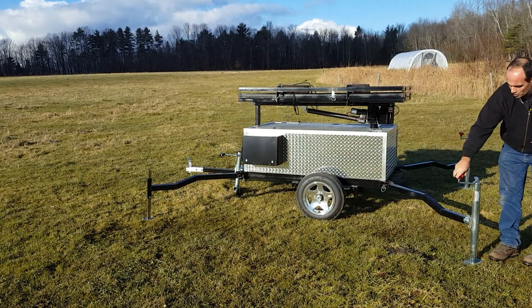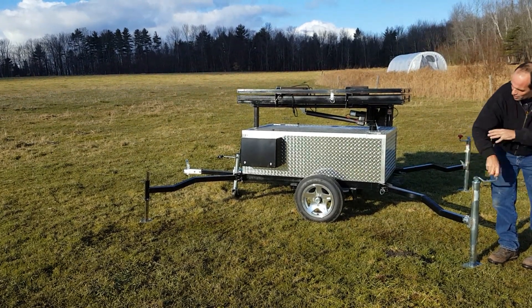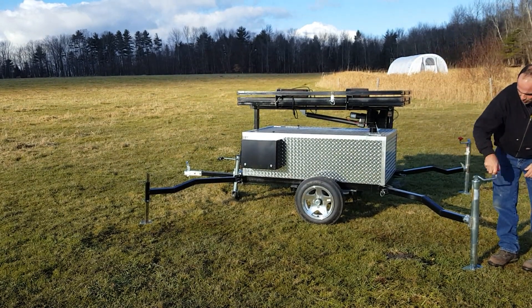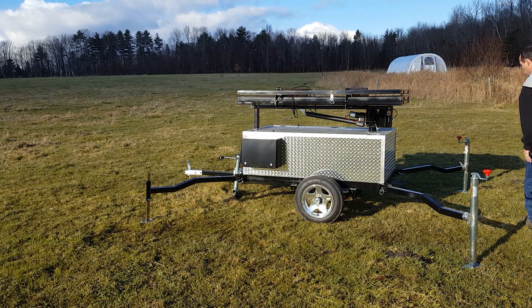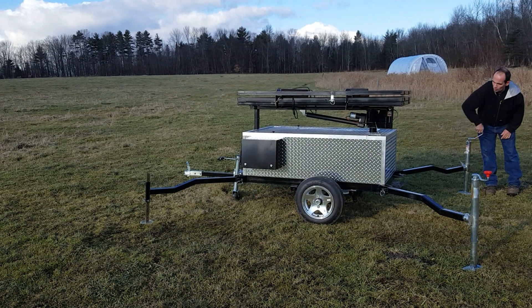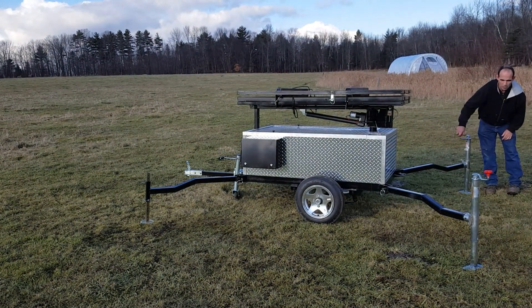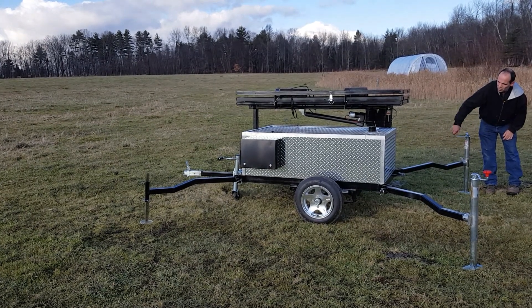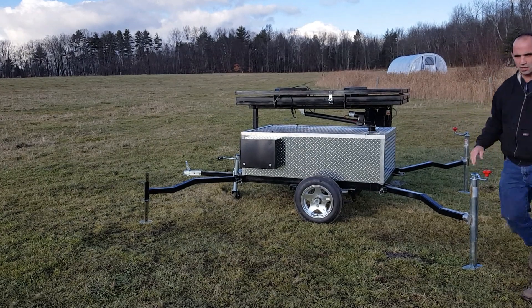Basically what I'm going to do is put tension on these rear ones here — I'm not going to raise the wheels or anything. Ideally you want the weight distributed on six points. This is the uphill side so I'm just going to snug that one up, and raise this one to level the chassis a little bit. It doesn't have to be perfect, just reasonably. And that's it — that's the initial setup for the stabilizers.